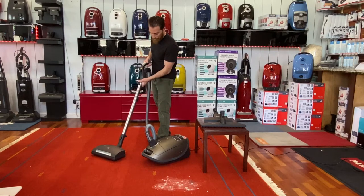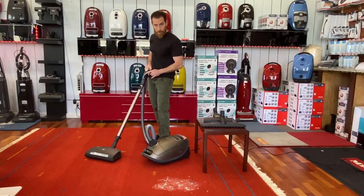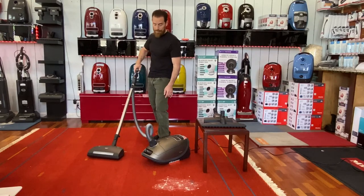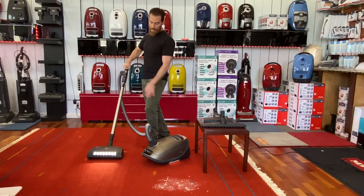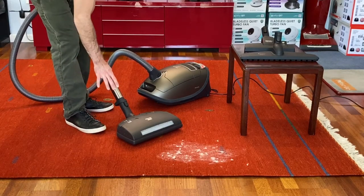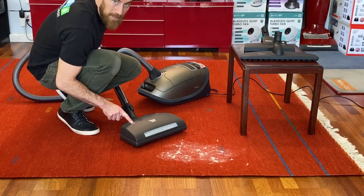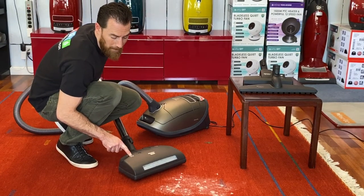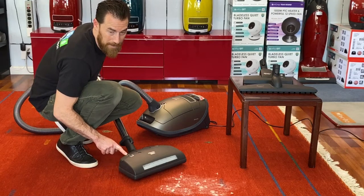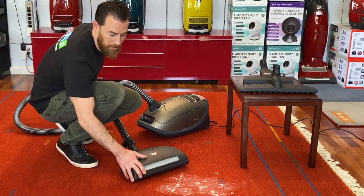The top button here is how you remove the hose handle. We're going to turn our suction on with the button that's lit up in orange. The button to the right of that is going to start our motor carpet head, and you'll know it's working when the light is on. Adjusting the power head is important for the type of carpet height you're using — there's a window with numbers five, four, three, two, and one. I recommend putting it on level five, then turning everything on and stepping down one click at a time until you hear the sound and pitch change or feel it grab the carpet.